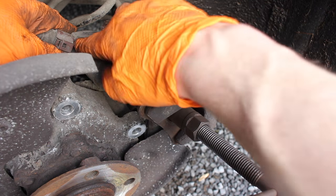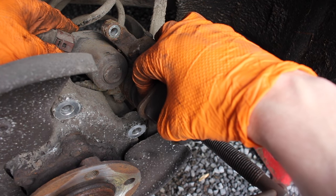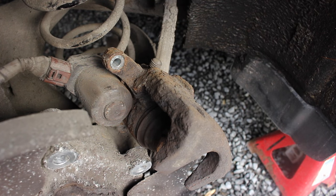This is because the motor, which lives here, has an auger screw in it that pushes the piston out. So when it's fully out, we can't push against it unless we retract the motor.